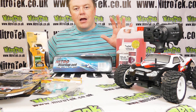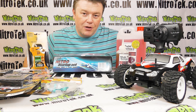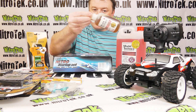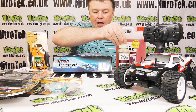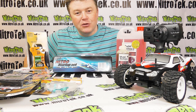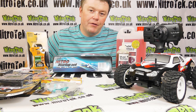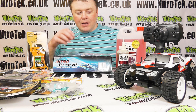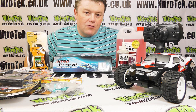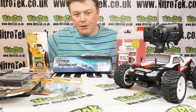After you've finished running for the day, it's a good idea to run lubrication through the engine, and we have after-run oil available. It's kind of like an insurance policy against rust in your engine between runs, particularly if you're not going to run for a number of weeks. If you want to store the vehicle away, you really do need some after-run oil there just to make sure that next time you come to run your car you don't have any problems.